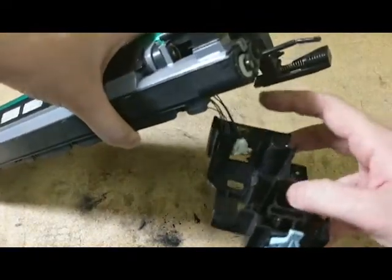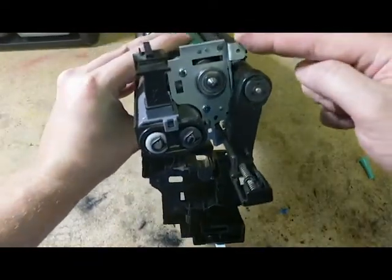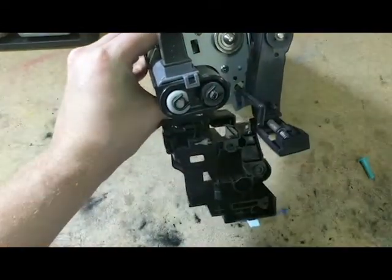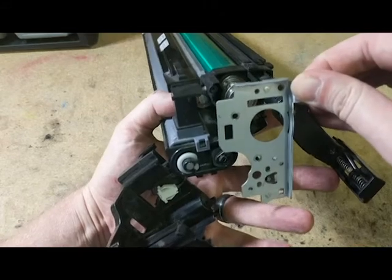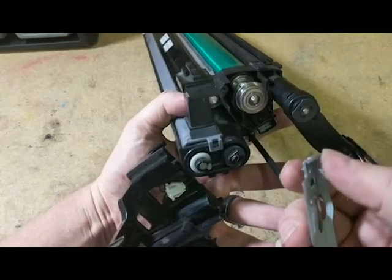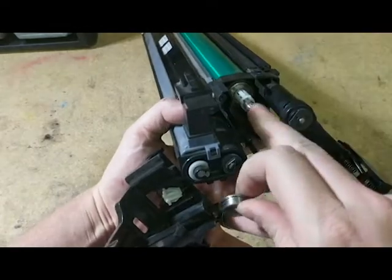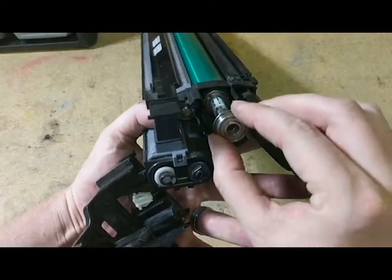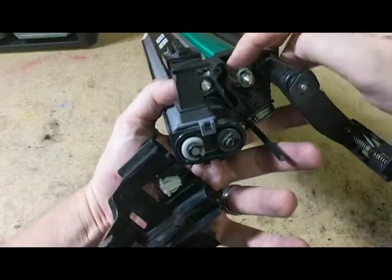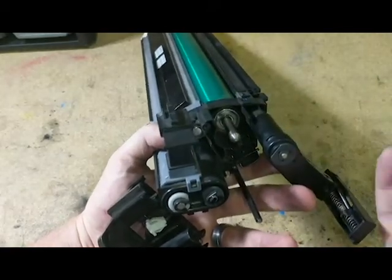You can see the plate is still connected with some electrical wiring. You can leave that on if you want, but if you're having a little bit of difficulty, you can disconnect those and reconnect them later. What you see on the end is a metal plate. This metal plate is the next thing to come off and it's held on by two screws — right there and right there. Once those two screws are off, this metal plate will just slide right off. Keep in mind how it is positioned — you want the flared edges going to the outside of the unit. We also want to take off the bearing on the axle going through the drum unit. The flared part of that is going to go towards the inside of the unit. Then the last thing is to take off the plastic clip on the axle itself — there are little squeeze tabs on either side that you just squeeze and pull off.